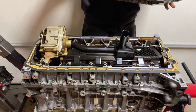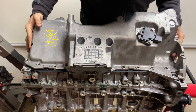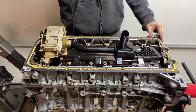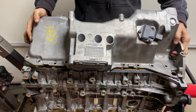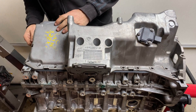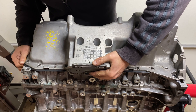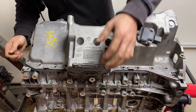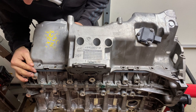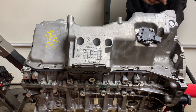Just as before, cleaning all of the surfaces is very important to prevent leaks, and then we can drop the gasket on top of the engine block. In this case there are no guides, so you have to be very careful when installing the new gasket as it will move around if you're not careful. It took me two tries before I got it perfect, and I had really good access, so I imagine it's a little bit harder while working under the car. With the gasket aligned and the oil pan sitting on top, we can insert the new aluminum bolts in a couple of spots and screw them in by a few threads. If the engine is out, you're supposed to use an alignment tool to make sure the oil pan is perfectly aligned with the block. If the transmission is still attached, you don't really have to worry about it as it will align itself to the bell housing.